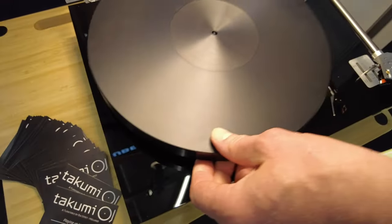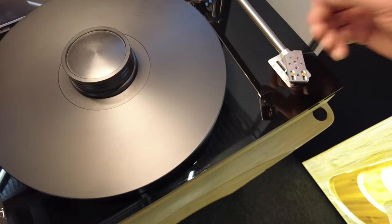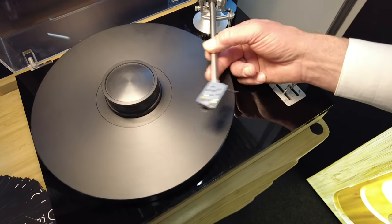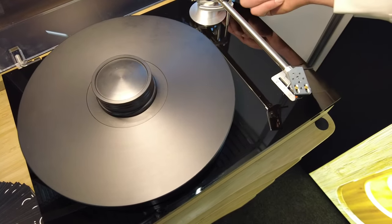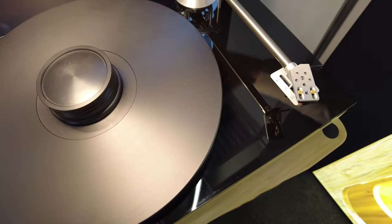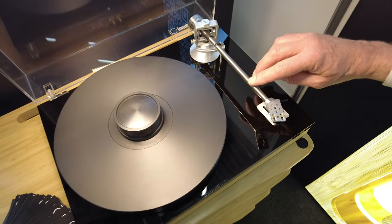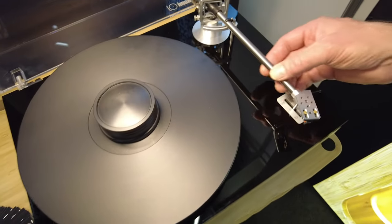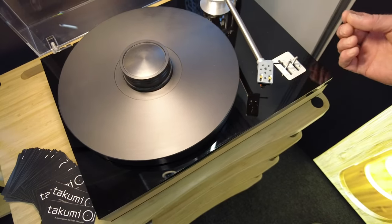We have another record deck playing in the booth. And it's a very nice arm, and you build that. Yes, we build it ourselves, and it's very basic. It's fully cardanic, so you can see. It has very low friction, and it has a disc in here with six magnets. So with the magnet here, you can control the anti-skating. And it's working very nicely. It's a titanium tone arm, so it's very light. Titanium, okay. Very light and stiff. And so it can handle a lot of cartridges.